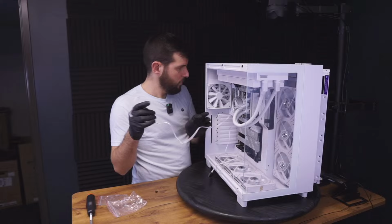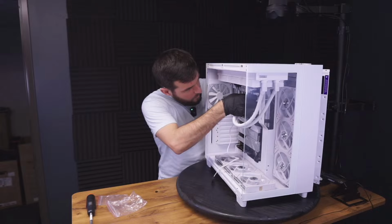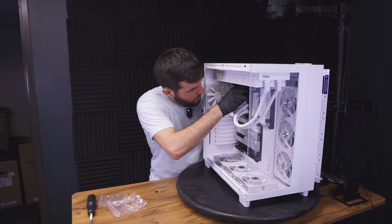Make sure on the 750-watt power supply, it's at least rated 80 plus gold, and it's from a good brand like Asus, Seasonic, EVGA. You can even go with like Thermaltake or something like that too. But do not skimp on the power supply. It is a very important component for your PC. Never skimp on the power supply. Especially since if you get a good one, it'll outlive all the rest of your components.